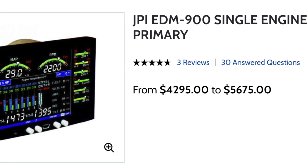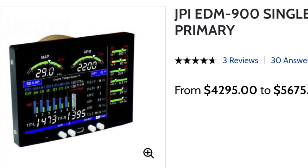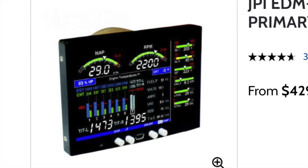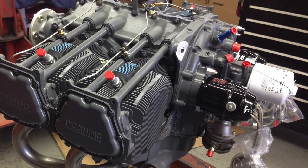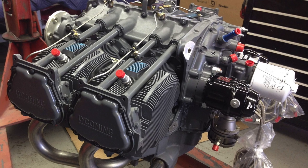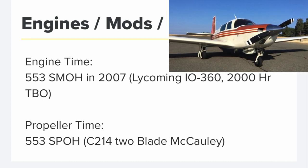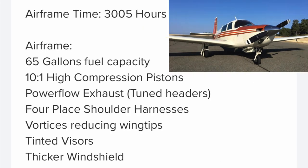With low- to mid-time fuel-injected engines on both of these planes, having an engine monitor and learning how to use it properly will provide the best chance of prolonging the life of the engine, which is arguably the biggest cost liability on any airplane. It might even let you maximize your efficiency by giving the critical information needed to run lean of peak. Both of these airplanes are equipped with a naturally aspirated Lycoming IO-360 variant, which develops 200 horsepower at sea level. The first thing we usually consider when talking about engines is time since last overhaul. In this case, the Mooney engine and propeller were both overhauled 553 hours ago — a sweet spot for engines, just past the premature failure period with lots of overall life left. The overhaul is also somewhat recent, taking place in 2007.